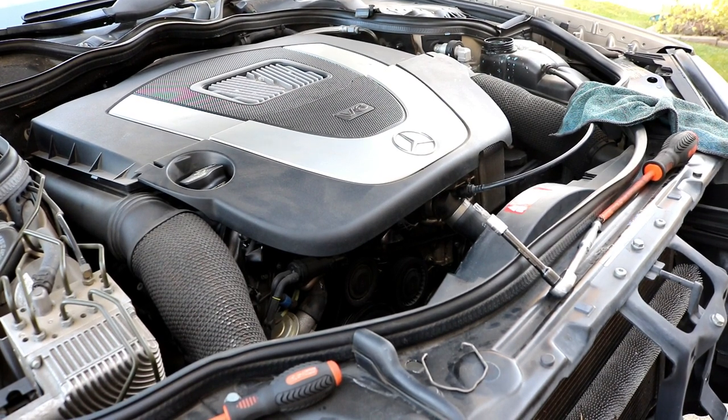That's all there is to it. It's a little more difficult than other cars to do a thermostat on, but definitely very doable at home. I'm doing this because this car had a P0128 code, which is extremely common with these engines. Since you can't buy the coolant temperature sensor separately, that's why you end up replacing the whole thermostat housing. I don't suggest aftermarket housings - just get the one from Mercedes. You can get them online or at the dealership. They always come with the gasket and fit right because it's made by Mercedes. If you have any comments or questions, ask them below. Hit the like and subscribe button on your way out.